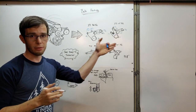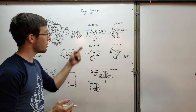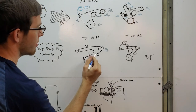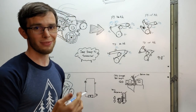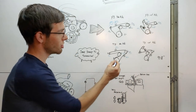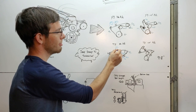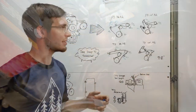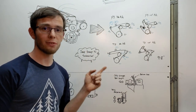Now, that's not what I did — I did something way more difficult but also rewarding. The TJ did this differently. Its layout is: power steering, crank, water pump, idler, and alternator. There's another idler which acts as the tensioner, and it moves on a threaded rod that comes up right at the top of the engine. You can throw a socket and drill on there and tension or loosen your belt in about three seconds — versus fighting with the YJ setup and getting your hand stuck in the fender well. Way better for tensioning.